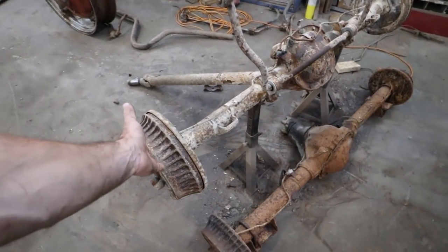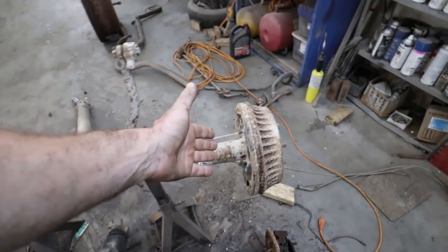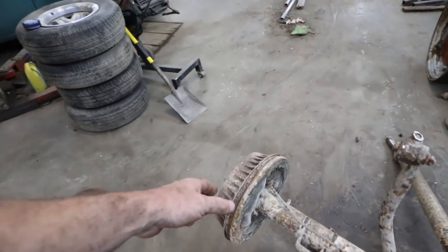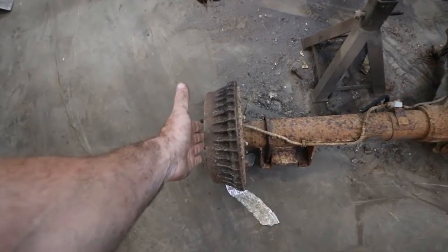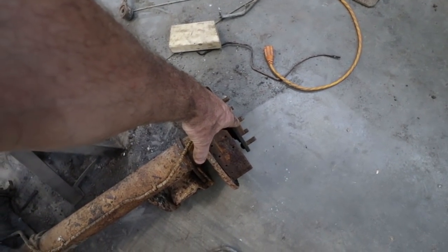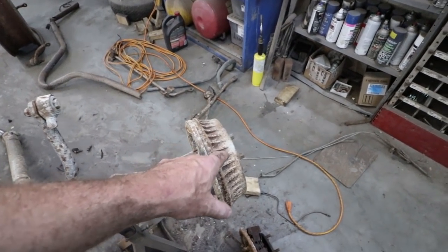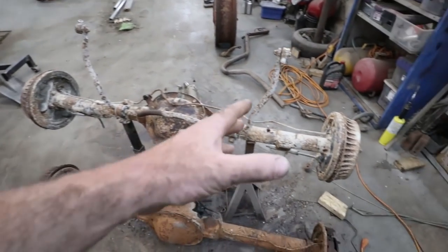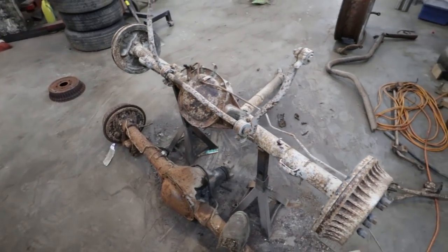That said, if you go mounting face to mounting face, because if you do back plates, that doesn't mean much other than trying to clear your frame, in my eyes. You have to know where your wheel mounts. So anyways, and don't quote me, but there's a difference. This mounting face to here, I think, is 60.5 inches, and the S10 4x4 is 59.75. I don't know how that would play into the car. These are the ones everybody used to always use, and they're getting harder to come by.